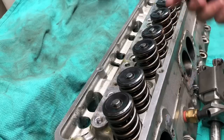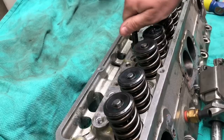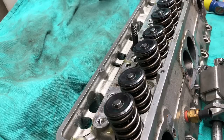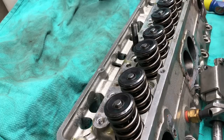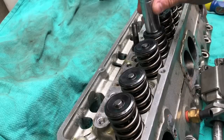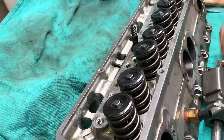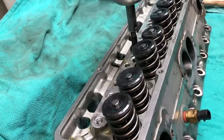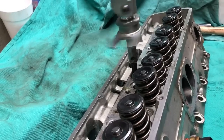I don't have studs in this one, so I had to get a stud out of another head. This thing is pretty simple — it just screws down in there, and then the tool screws down on the stud and locks in place. These are PAC 1226 springs, I think they've got like 350 to 375 pounds on the seat — set up about 350, so that's a lot of spring pressure. One thing you always want to do before you take these off: take a socket that's bigger than the stem and lock, and just smack it a couple good times. All that does is loosen the lock a little bit so you can pop it off.